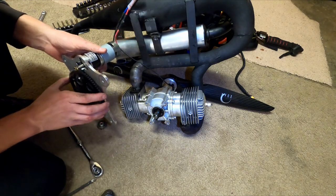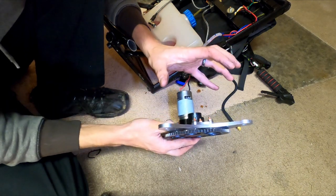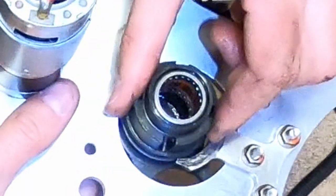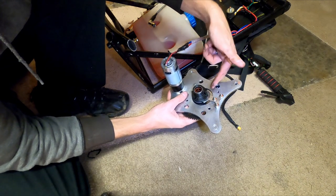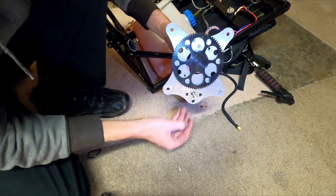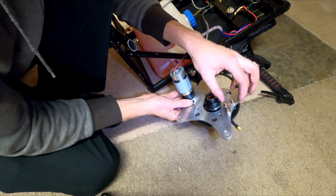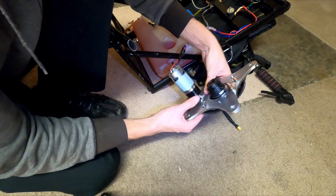Aha! Okay, interesting. So I'm figuring this out as soon as you are. This whole back plate, of course, is an addition onto the DLE engine for the paramotor specific version. This gear houses the one-way bearing inside of it. That's it right there. And then it's got this little fork that keeps the gear from sliding out. So you don't have to take off the pinion gear off the starter motor, right? So that can stay on there. You do have to get to these three bolts to get this fork off so that the whole gear can come out, because the one-way bearing is attached to the gear.